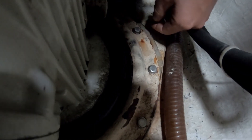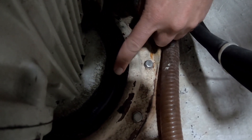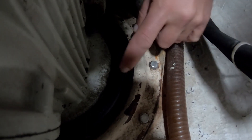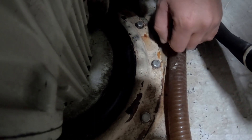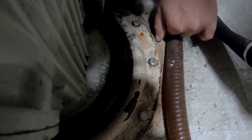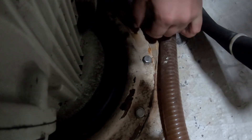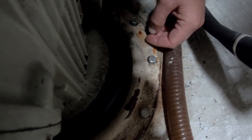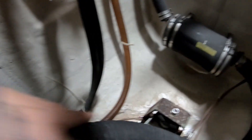It's recommended that this rubber boot gets replaced every seven years, and we have absolutely no idea how old this one is. For all I know it could still be original, which would make it 31 years old. So I'm going to pull it out and replace it, and make sure everything is good for the big trip back home to New Zealand.